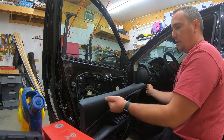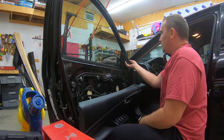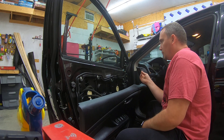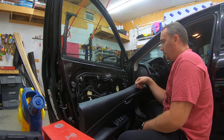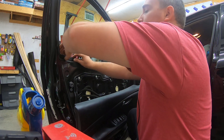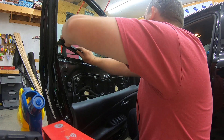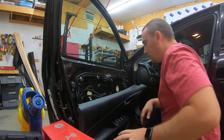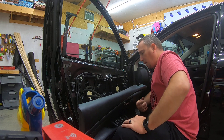It's a fast motion — up and then out. You can see this trim right here flipped up. Grab this trim piece and pull it straight off. You don't have to do this first — it's completely up to you. I put the panel out and then put that on last, just like I took it off last. The window sill trim pulls straight up — there are no clips or anything, it is tension, so just pull it straight off.